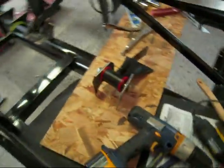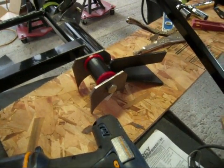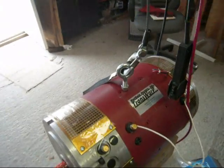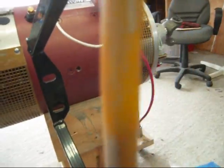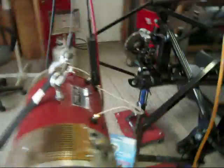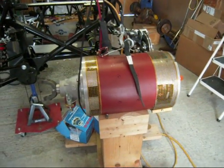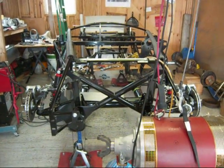There's a third set of mounts that I've started construction of that will be part of a belly band that will go around the middle of the motor, bolting in through that top bolt hole there in the middle and also one more down along the side. Those will be primarily to arrest torque. The front and the rear mounts are simply to hold the weight of the motor. So that's where we are at the moment — stay tuned, there will be more videos to come.